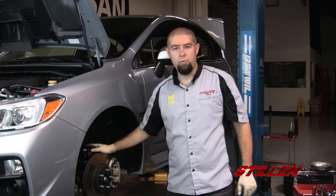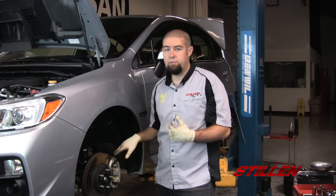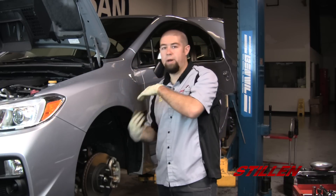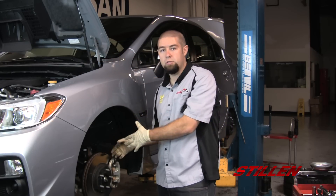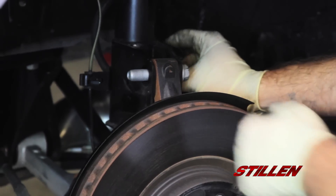It's always important that when you're disassembling your front suspension, you want to make sure that you get all of your accessories out of the way first before you start to move to your top mount bolts. That way, when those release, you don't have to worry about anything getting tangled up or having to deal with those later on. So the first thing to do is remove your brake line bolt, and then you're going to want to remove your ABS sensor.